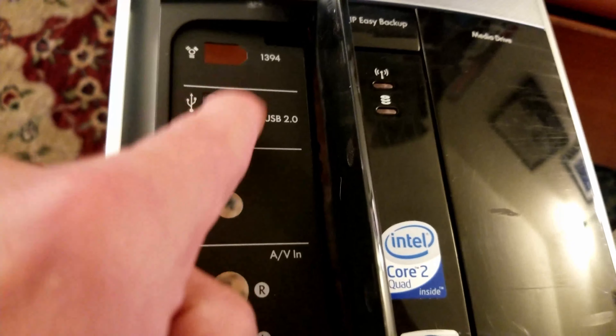It still wouldn't boot, and nothing was getting hot — that's why I thought it was the power supply. But when I took the CPU cooler off, there was no CPU under there. The Q6700 was gone. Also, there was no RAM installed in the system — just two gigs of DDR2 RAM for testing. I put in a Core 2 Duo real quick and was able to boot to the BIOS, so I at least know the board is working.